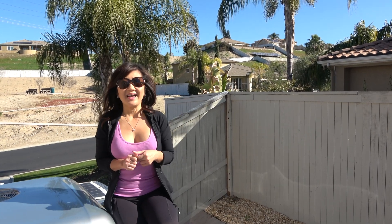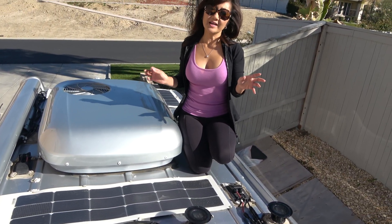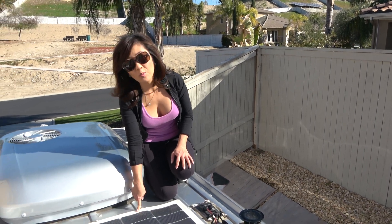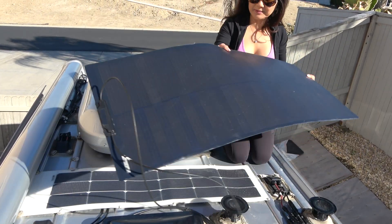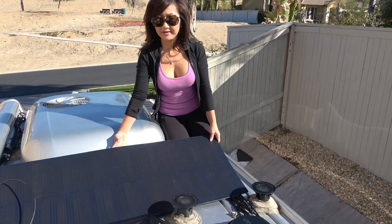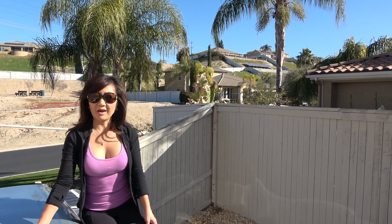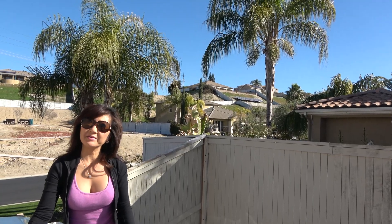And we watch TV, turn on the lights — sometimes it's not enough. So what my husband did is he switched the two big panels, the two 100 watt panels, and connected them to go to the house battery. Now in place of the 50 watt solar panel we're going to put in a 100 watt panel right here, so we'll get 300 watts for the house battery. We won't have any solar panel going to the chassis battery, but we're okay with that because even when we're at home we always plug it in on the side of our house, so it will charge the chassis battery for us too.